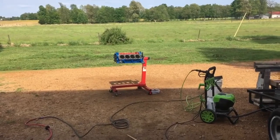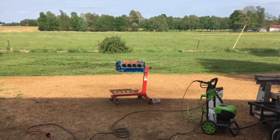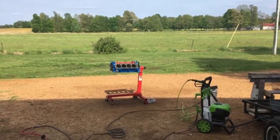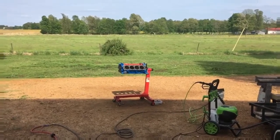I did a little painting because not painting an engine is just lazy. I also painted the inside of the lifter valley with a paint called Glyptol. You can sometimes find it at electrical supply houses. It's oil-shedding, oil-resistant, bonds to the metal really well. It makes the oil not build up sludge in there and makes it return faster. Plus, it makes our motor look like a racing motor to some people.